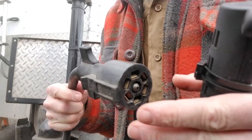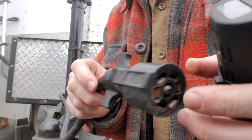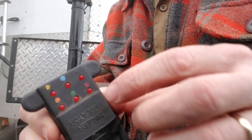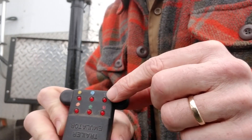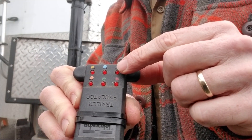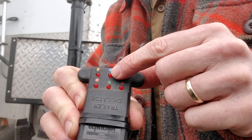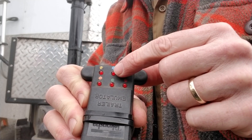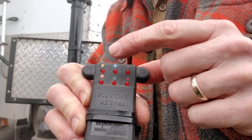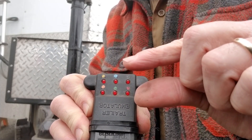Let me preface this by saying that not all manufacturers follow the wire codes, and that's kind of crazy. But overwhelmingly, starting here, your black wire is going to be always 12 volts hot. Your blue wire is going to be your brake. As you press your brakes, a different amount of 12 volts goes through — full 12 volts is a locked-up brake — but as you press harder and softer, it's an analog value that's changing.